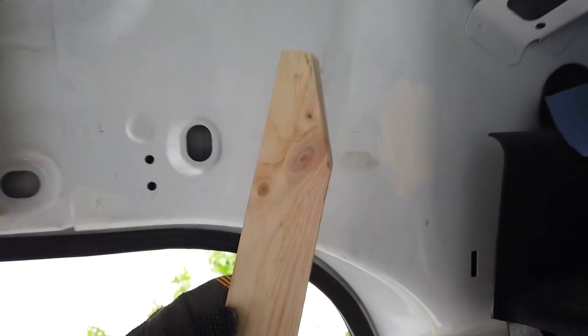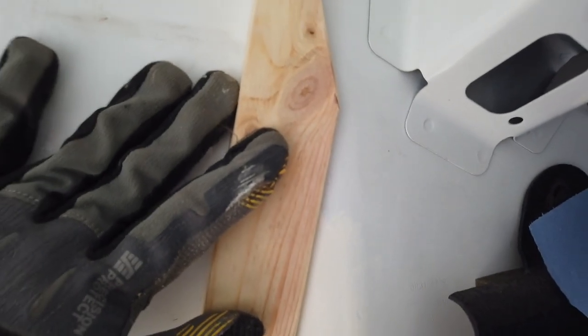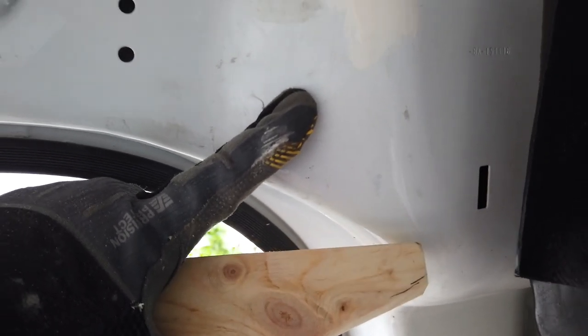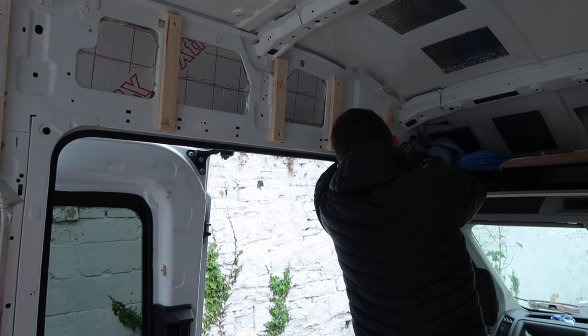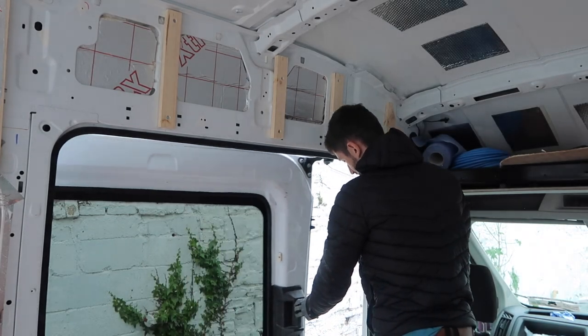What I did instead was I cut this shape — it's kind of a wedge with a wedge on it. I'll try to put it there, and then the screws can go in through this bit, which is quite a lot thicker, so there's no risk of me breaking the outer skin on the door rail. And that is not going anywhere! So what we've done here — and what we need to do to the entire van — is put up these wooden battens all around, usually referred to as furring strips. What these do is give us somewhere to screw the wooden cladding into, instead of directly into the metal.